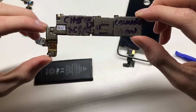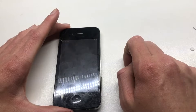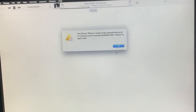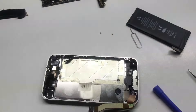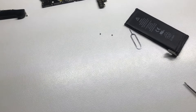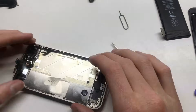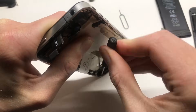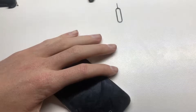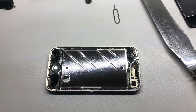The next one we're taking a look at is the one that I think says 'cooked screen' — from last week it was on the setup screen and it had an iCloud account in it on the iOS 7 setup screen. I erased it, but now putting it in a housing it just won't activate — I'm getting an activation error. Strangely, it was literally working before: I set it up and added an iCloud account, but because it had never connected to the internet it wasn't activation locked. Now after erasing it, it won't set up. I might have to call Apple about that error. Basically, I'm going to change the screen on this housing to make one complete iPhone using the fully functional 32GB logic board from last week.